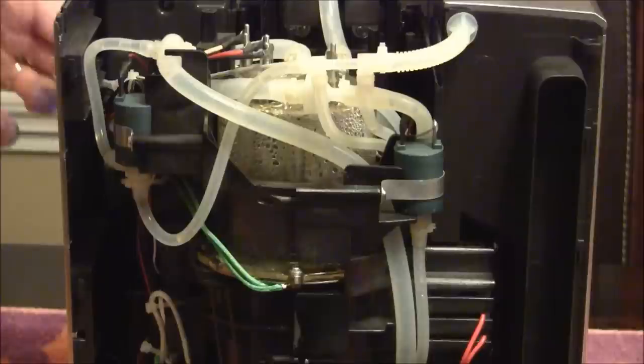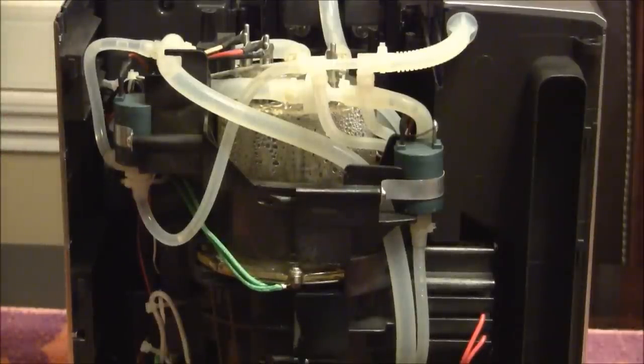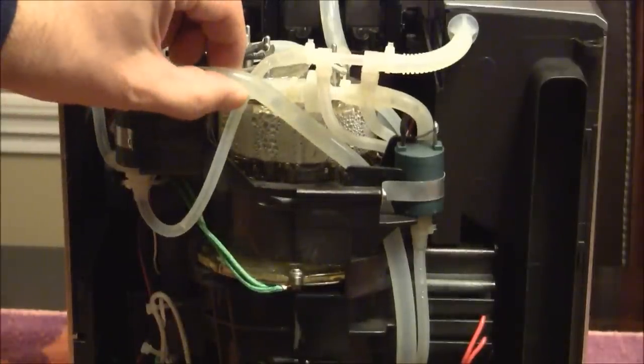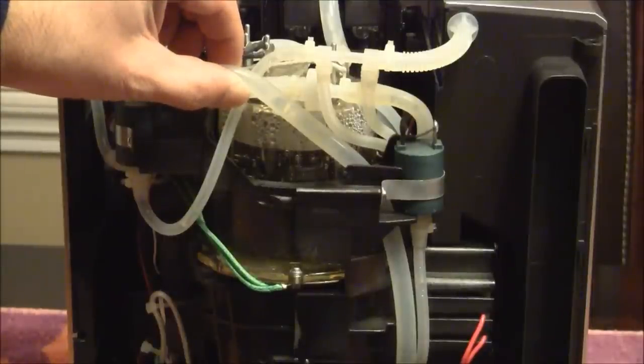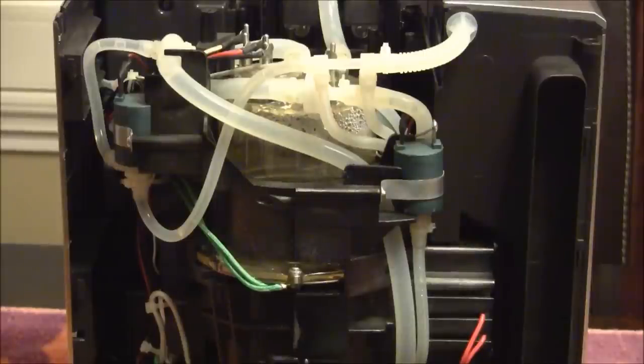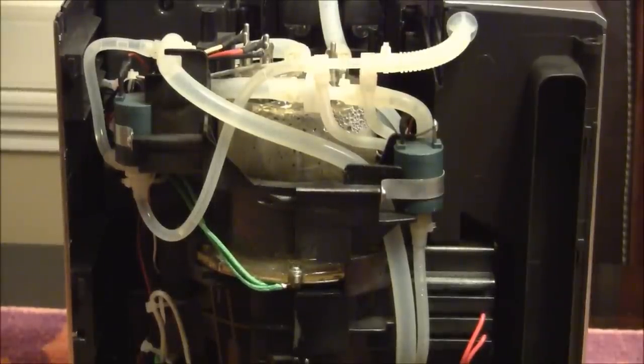Okay, here's the back off the machine. What I'm going to do is press the brew button. You can hear the water pump running, and you'll notice how quickly the water pump is able to fill the boiler. The water is going up very quickly, and as soon as it gets to the prescribed level — in this case it was for the second tallest cup of coffee — then you'll hear the air pump come on. The air pump will then pump air into the boiler, which pumps the coffee out and into your cup. As soon as it's completed that procedure, it will then begin filling the boiler up. It won't fill it to the top again, but what it will do is fill it up to the smallest cup of coffee ready to brew, and then if you choose, it'll add more for the largest.